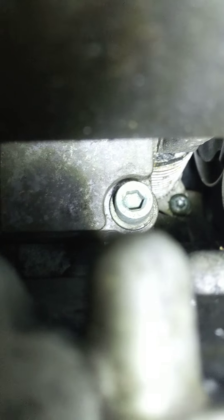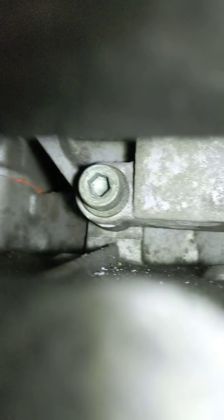So could it be my oil cooler? Doesn't look like it. Does not look like it's my oil cooler. Even my oil drain return right there isn't leaking. If it were the oil cooler it'd be all up on top of here — I don't see that. There's some oil up there by the head gasket area, but the rest of this is fairly dry.